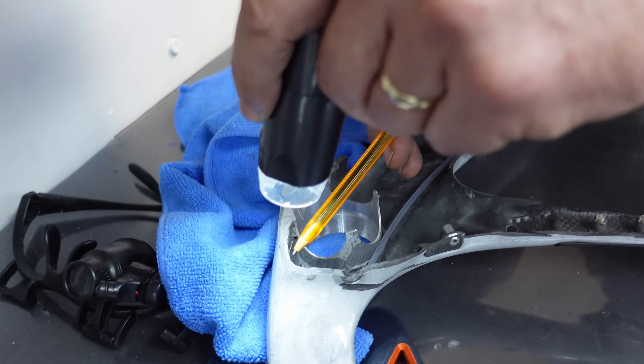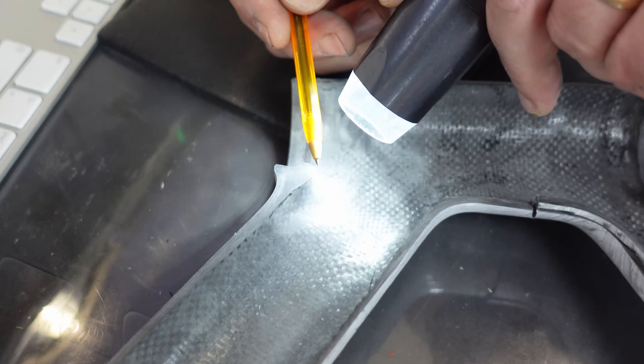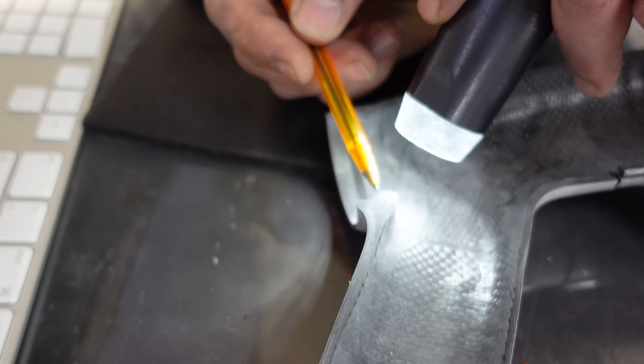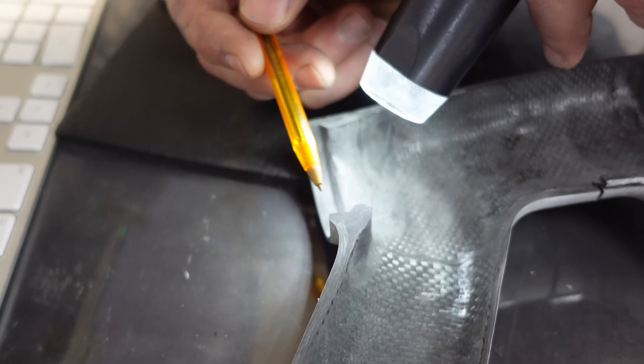Again, there are no square edges on these sides here — they're all rounded off. Except on the bearing cup areas, where you're going to have stiff areas, but these are thick molded chunks of carbon which are no longer even composite anymore — they're just blobs of glue and carbon making up a solid chunk there.